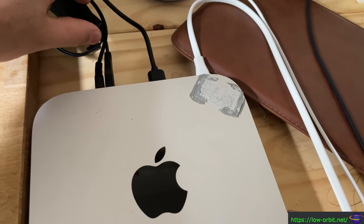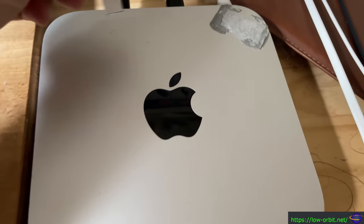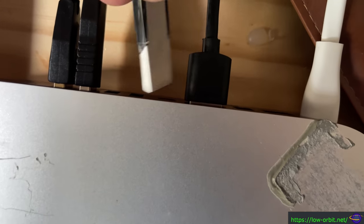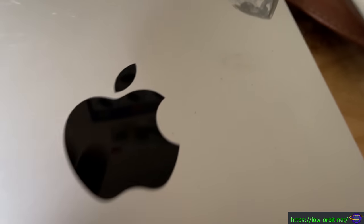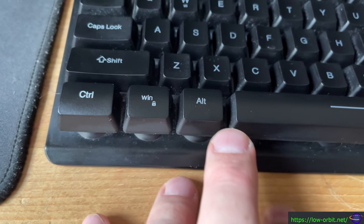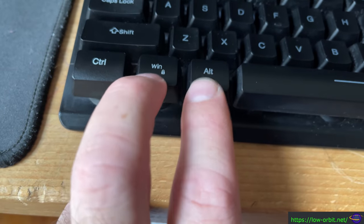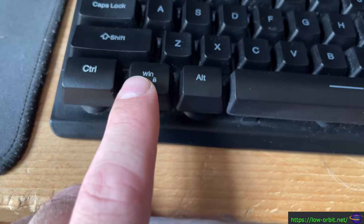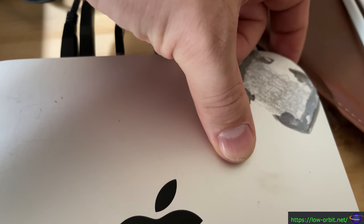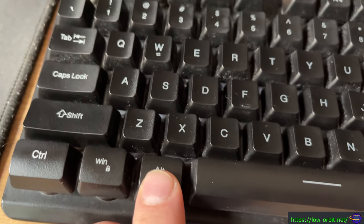So here we are. I've got this plugged in in a temporary location, hooked up to an extra monitor. Let's stick the USB drive in here — basically just sticking this SanDisk USB drive in here. It is a bootable ESXi install drive. I'm going to hit the power button on the back here, and we're using a PC keyboard, not an Apple keyboard. So we're going to be hitting the Alt key. On an Apple keyboard those two keys are swapped around, so you'd hit the middle button. As it boots up, you're going to hold that button down.